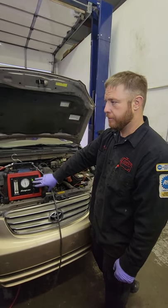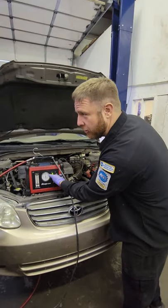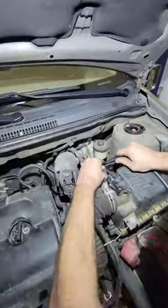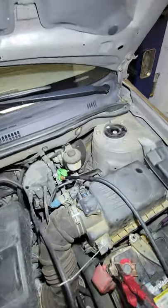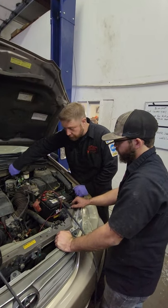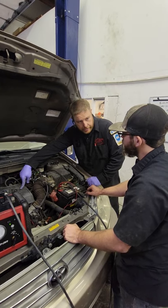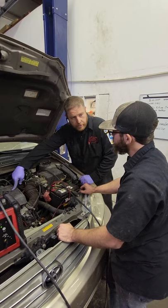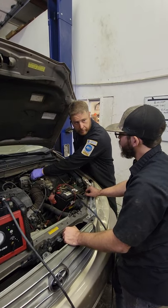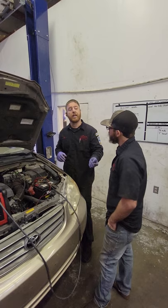What I tell my guys is: once they have everything set up, turn this on and then come back. Sometimes I'll come by and there's no leak but things have turned off — it will go to zero if there's no flow or pressure. We'll go ahead and put it in there, then we need to access and locate the vent valve or vent hose. This hose is going to go back most likely to the charcoal canister tank. This other hose goes to a purge valve, which also has a hose to the intake for vacuum. That vacuum is always at the purge valve; when activated it opens, allowing vacuum to pull the vapors out of the tank. Now we're going to go up and find the charcoal canister on this Toyota.